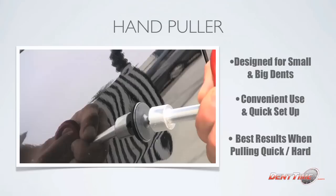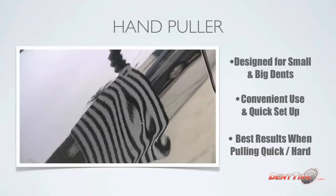I use the hand puller a lot, basically for pulling the low out when I have a nice crown. It's a very great tool — I whip it out really quick and fast. You'll be surprised how well you can snap dents out with it and how much control you have. You can even pull out a big lion's share of the dent. If I was to pick any tools, I'd recommend the slide hammer and the hand puller. The mini lifter is great too, and if you're a professional who wants all three, I highly recommend it — the more tools, usually the better.